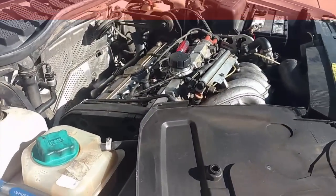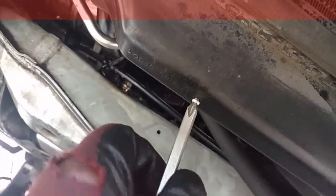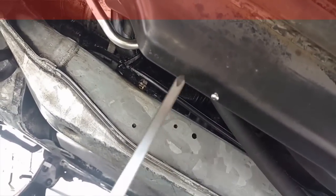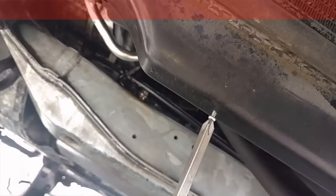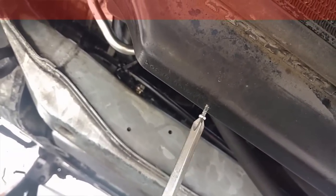Let me get it back together. Last night I noticed for some strange reason somebody blocked the weep hole on the turbo intercooler. So I've got to get that screw out of there, fire this car up, and test it. This is the weep hole that's designed to take the oil out of the intercooler system and turbo piping system so that it doesn't blow it all back through the engine. So don't block this hole — it's there by design.